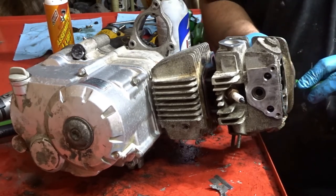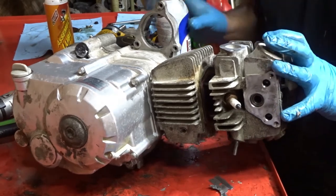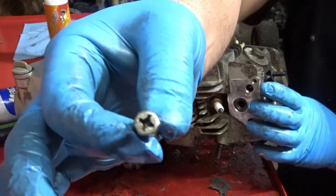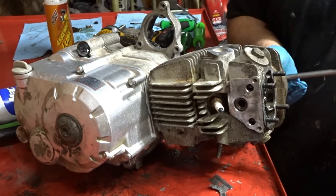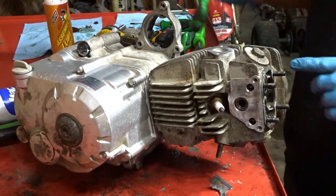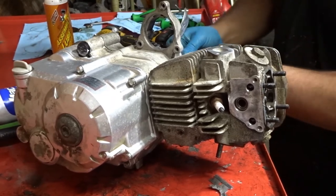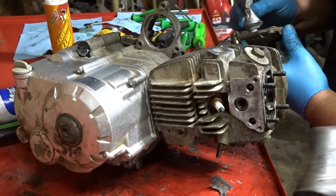Take the pick, hold the timing chain — and what do we do? We don't drop the timing chain, guys. Make sure you still have it. You remember this bolt from last time — same thing. You're screwing the cylinder head to the cylinder, you don't tighten it. Take some gasket maker. Yeah, I reuse, re-plug.